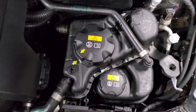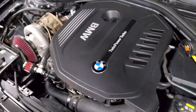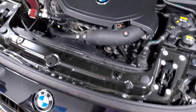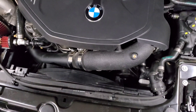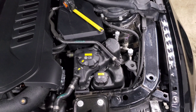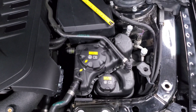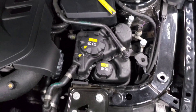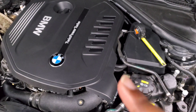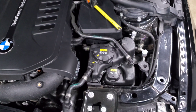This larger reservoir is part of your high temp cooling circuit, which supplies coolant to everything else — your engine block, your turbo, two auxiliary heat exchangers on the sides, and one additional main radiator sandwiched behind the intercooler radiator. All hoses related to your main cooling system pull coolant from that large reservoir. If you replaced anything that required draining that reservoir, you'll need to do the bleed process for your high temp circuit. This circuit has two pumps — one mechanical pump on the front of the engine block and one electrical pump towards the back — so you'll need to bleed both.